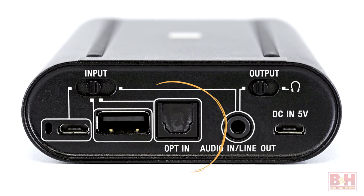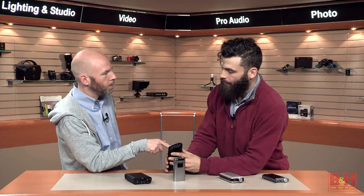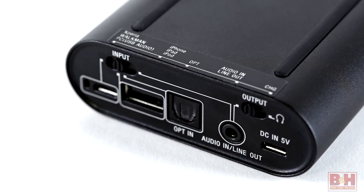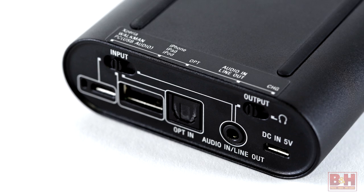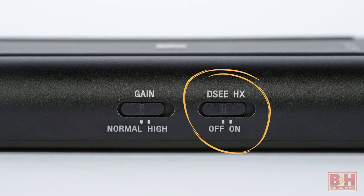It also has digital input. Like I said, you actually need to plug in two USB connections — one to provide power to the unit and one to do the conversion from your phone. There is an internal battery, but this design is pretty high audiophile in the sense that they're imagining you'll be using it at work or at home, though it's still portable enough to bring on your commute. It has optical in as well, so you could be feeding it from a transport or CD player. One really appreciated feature is the DSEE HX switch on the side, which will upsample your content to a higher resolution — adding samples in between existing samples to more closely replicate the smoothness of analog, smoothing out those digital steps. You can hear the effect when you flip it on; it makes the music more engaging.